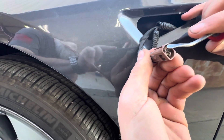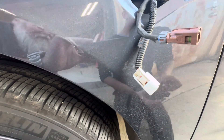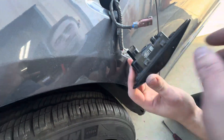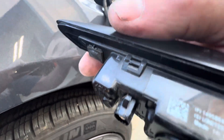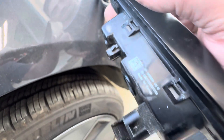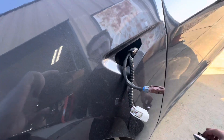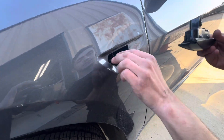That's the piece where we're trying to push up and lift that tab. As much as I hate to say it, you can break that plug before it will release. You can see that little nub — you just have to get that tab to go up over it. Do not force it, do not tear your plugs up. They're wired into one of your main wiring harnesses.